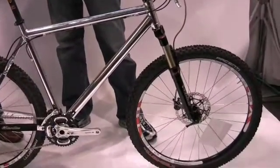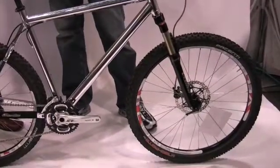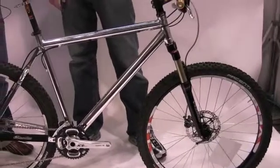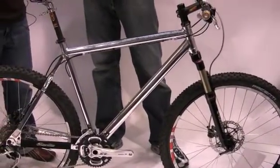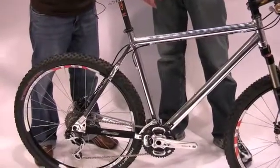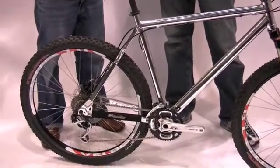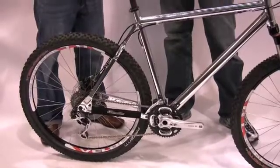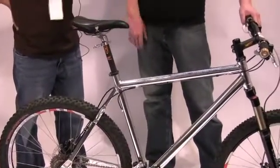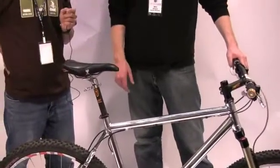In terms of the wheels and tire selection, these are Pacenti Neomoto 2.3 tires, so pretty large air volume tire. They're mated to a Velocity Blunt 650 rim. Again, a pretty wide rim, so it's definitely more on the durable side of mountain biking. Right. Not a lightweight setup, not super heavy, but definitely not light, not race light. Right. More everyday, durable riding.